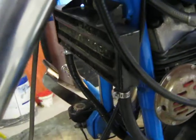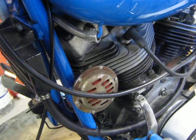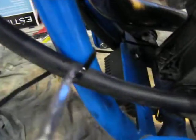That's a Harley Davidson oil cooler. The bike's up to about 84 — this is a 1984 FXWG Wide Glide. I've connected it with a bolt on the frame where the horn was. I'll put the horn at the side. Then at the exit from the oil cooler, I've got a clamp and a plastic tie there. It runs along the top of the big end and around the upright in the frame. On the other side of the upright, I've gone underneath the hoses to keep it down and away from the exhaust pipe. It's clear of the clutch gear stick — it's underneath that.